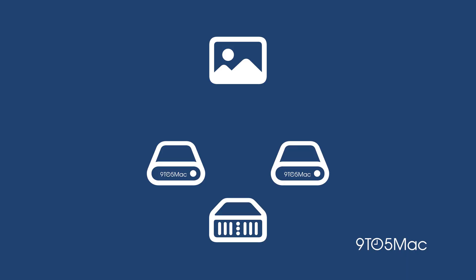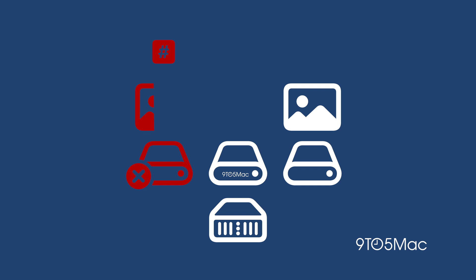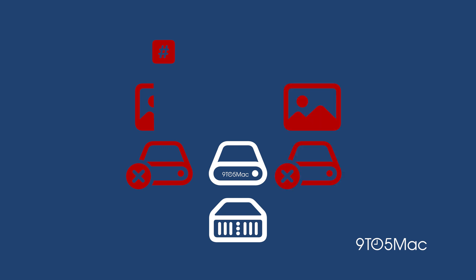You may be familiar with RAID, where you have a group of drives and whatever data you have is spread across multiple of them. Some configurations, like RAID 0, just put half the data on each drive to get double the speed, while others, like RAID 1, put the same data on multiple drives so if one fails, you still have all of your data. Most RAID versions offer a combination of the two. RAID 5 spreads data across multiple disks but includes parity data, so if one of the drives fails, you still have everything. The problem with RAID is that if more than one of those drives in a RAID 5 fails, all your data is gone. There are different RAID configurations that offer more or less redundancy, and it gets way more complex than this — but in any of them, to keep it simple, there's a set number of drives, and if you exceed that number of failures, all your data is gone.